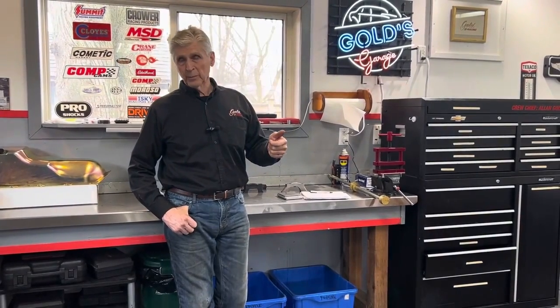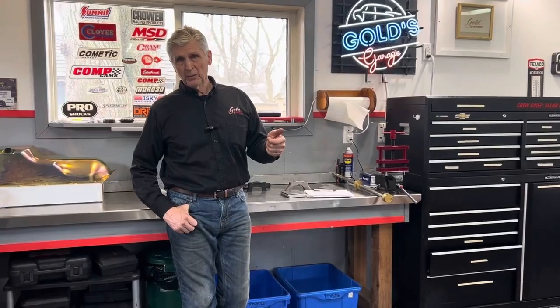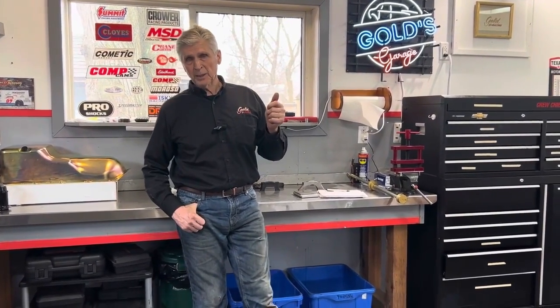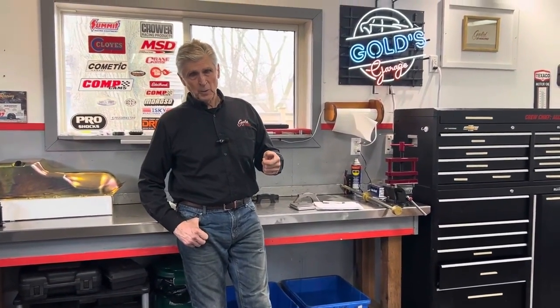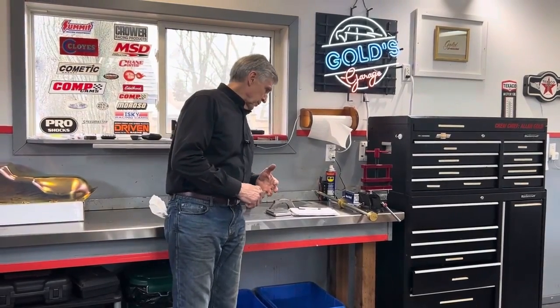And so we think, we haven't done the final numbers, and we'll do a check, we're going to have only 170 psi of cranking pressure or so. So if Mike uses good pump gas, he does not have to use race gas, and that's a big advantage. Cost-wise, race gas is expensive and a lot messier to handle. You can use pump gas, and this engine should not suffer detonation.